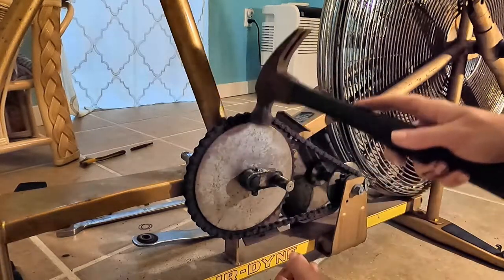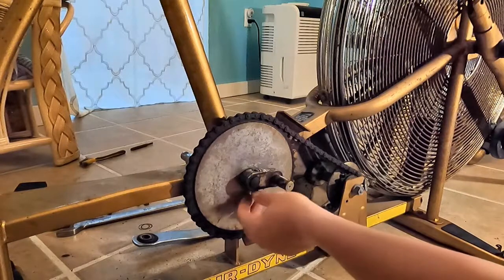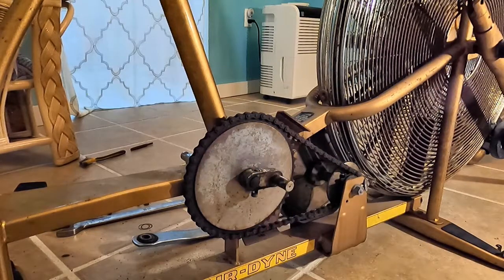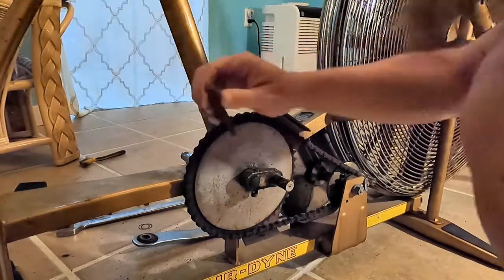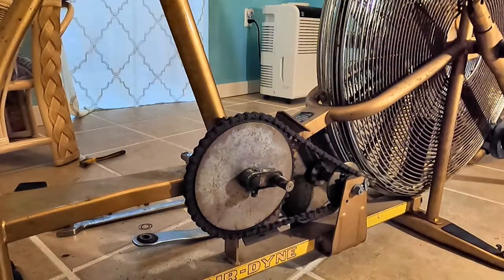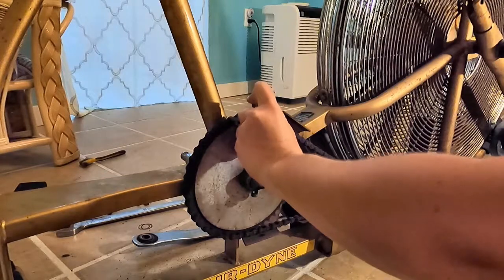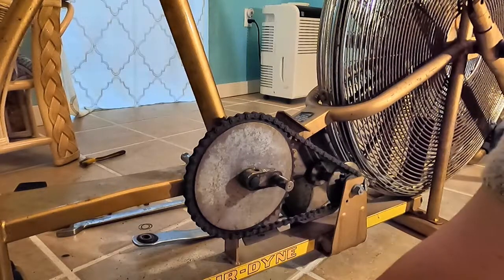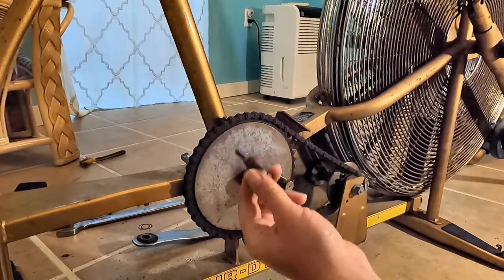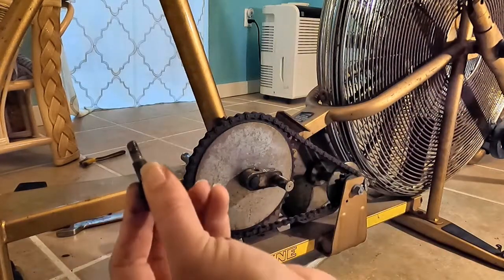Now the pin has moved a little bit. You can take it off and hit it a little bit more and it should come out without messing up the top, because obviously I can't screw to it now. But you'll have to forgive the state of the tools. They are not mine. So I'm going to use a drift to tap that down. And you just want to tap it. You don't want to manhandle it because you'll mess this up. And I don't want to have to stop to order another part. So actually the threads on this pin are already quite messed up.